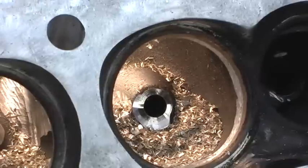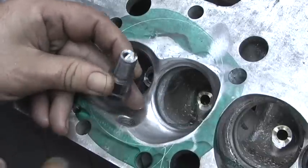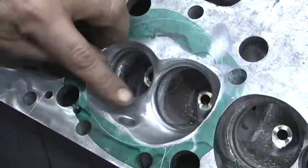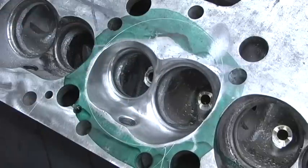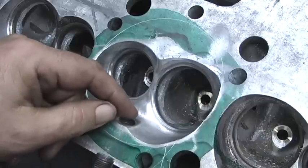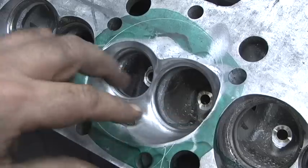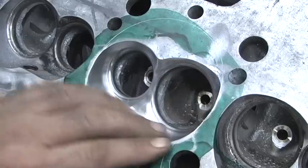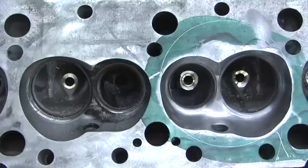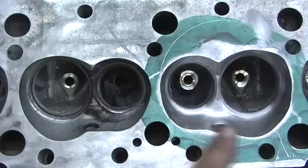That's why when you buy a pair of these heads you go in here and do this to them. Another thing I wanted to show you was I took a 3/4 inch spark plug, knocked the electrode off, and screwed it in place. I went in there and cut the chamber here, here, and here. It had a little bitty divot because the end of this was sunk down almost 300 thousandths and the electrode wasn't even showing hardly in there — so we had a fire control situation. By cutting all this out, I ground it, went ahead and gasket lined it, scribed it to match, cut the chamber, and polished it to a 400 grit polish. Now I'm going to have plenty of spark plug exposed.